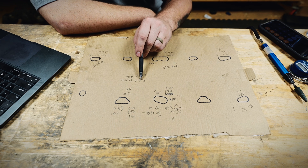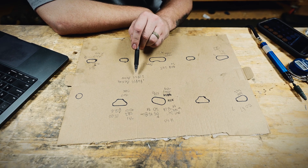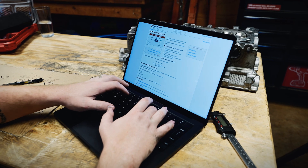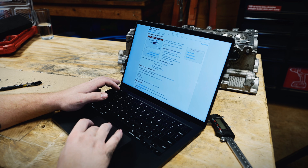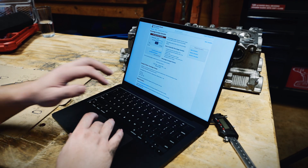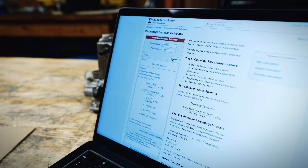I added up all the cross-sectional areas before and after porting. Starting value: 0.94953. Final value: 2.7923. So we had an increase of 194% across the oil drain backs.